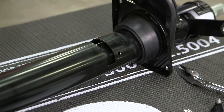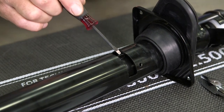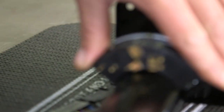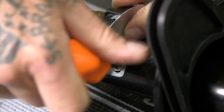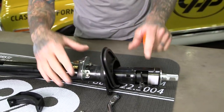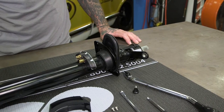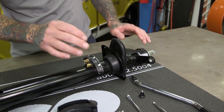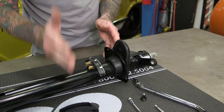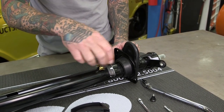What we're going to do first is install the safety neutral switch. It rides back and forth and engages this little tab inside here, so make sure you get that tab inside that notch — it's very important. Once you get it on there, go ahead and feed your two screws on. I'm going to leave these a little loose so when you get in the truck, you can fine-tune it once you get your gear shifter on. One really important thing: make sure your grommet and retainer plate are on the side of your safety neutral switch closest to the firewall. You don't want it on the other side because it's not going to seal anything, and it'll be a lot harder to get off inside the truck because it is so close to the firewall.